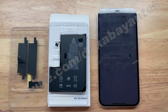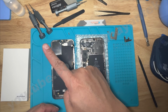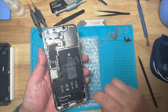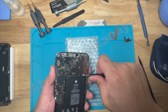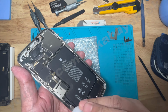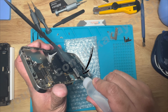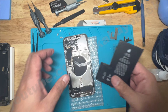So let's open up the phone, remove the security screws and take out the battery. I removed the screen. I do have another video of removing the iPhone 12 Pro Max screen, as shown above and in the link in the description box. There are 4 tabs of the battery, 2 at the top portion and 2 at the bottom. I'm going to remove only the battery top part tabs and use 99% alcohol and a black stick to remove the rest of the tabs. Be mindful of the BMS board at the side of the battery so that it doesn't get bent before removing the battery. Let's clean the remaining adhesive and use a manual blower or brush off the dust.